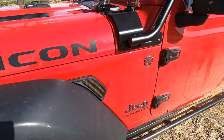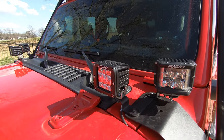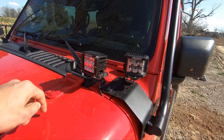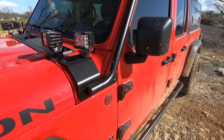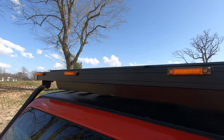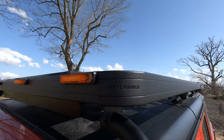On the sides, I replaced the fender vent with a set of turn signals that are spliced to work off of the factory function. For the cowls, you can see the front supports for the Frontrunner Extreme roof rack and two sets of Rigid pods on top. These pods are mounted on a Baja Designs dual pod mount that is bolted through on top of the Frontrunner bracket. I only recently installed these clearance lights — four amber lights up front, and once we get around to the rear, I'll show you the four red ones back there as well. These are all wired to the S-Pod on one switch.